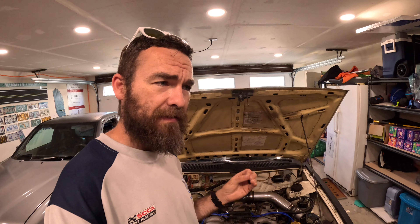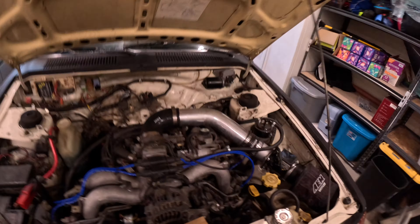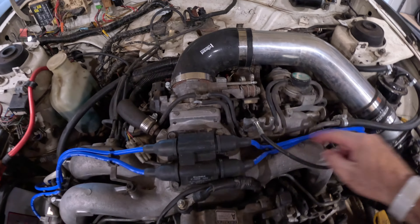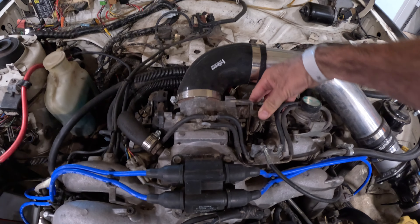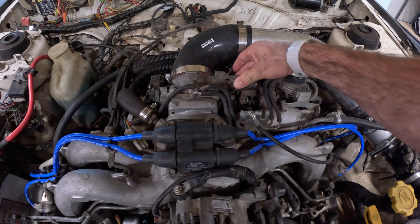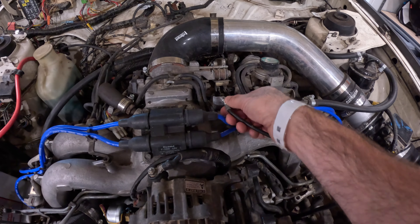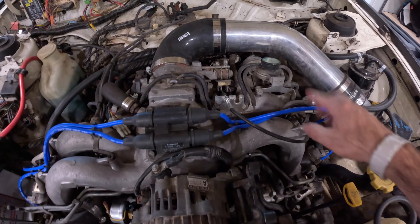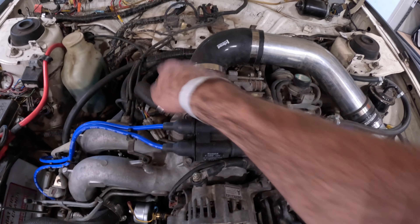The reason we're replacing the TPS is because on the OBD reader at full throttle it was only reporting 55% throttle position and about 60% engine load. Right here is where the throttle cable goes in, and I've had to adjust this a couple of times to get it to fully articulate — there was a physical block, so it was only going about this far. We moved it back and let the cable out a little, which helped, but I still wasn't getting full engine performance, and I think the TPS is the reason why.